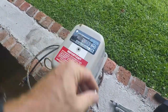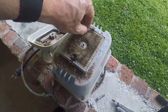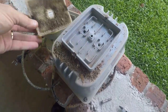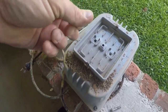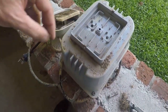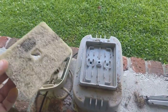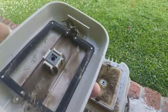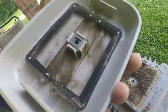Just for grins, I unscrewed the screw and yeah, that could have been one of my problems. It isn't much of a filter, but you can see the oil coming out of the inlet — so yeah, it died. These inlets are completely plugged up with gunk because I didn't know there was a filter under there. So if you have one of these, it says to check it every six months and change it every year. Probably worth doing that if you don't want to spend $300 on a replacement.